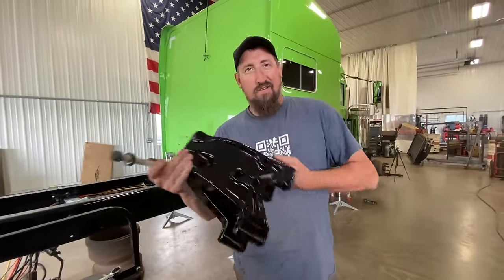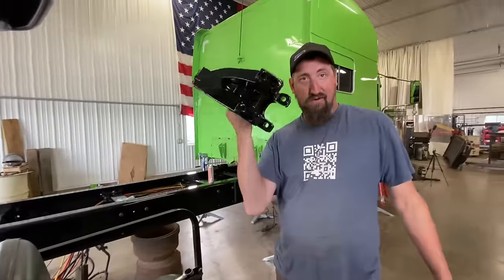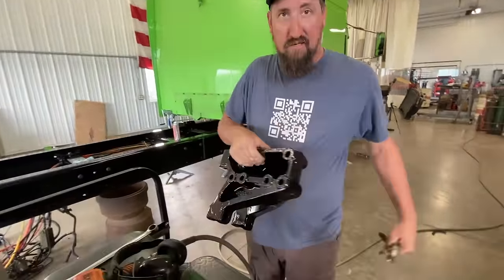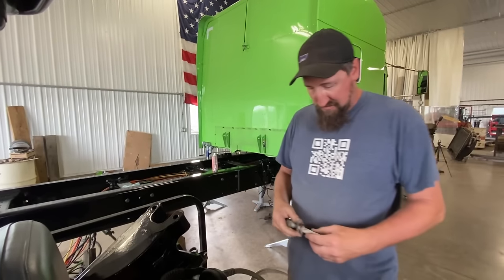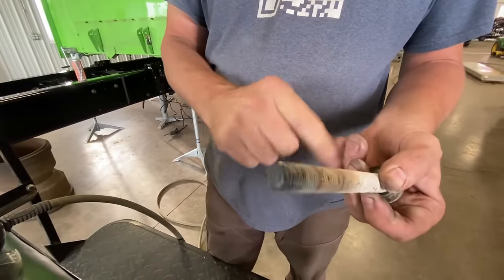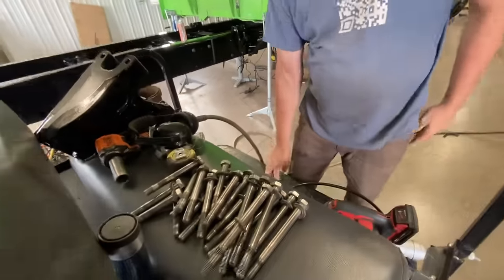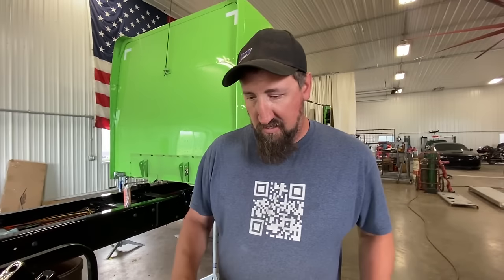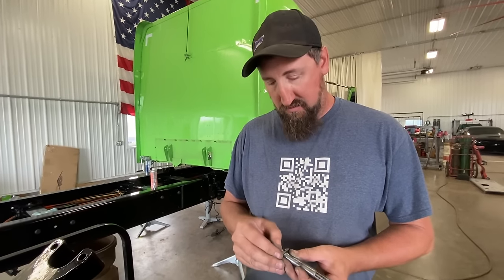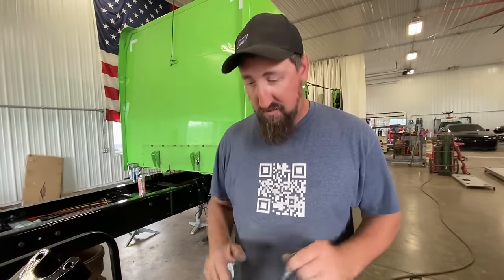So we're putting suspension hangers on. We've got these powder coated because all that needs to be cleaned up. We've got a steel bolt that has all that corrosion, see? Now we don't want to just go sticking that back in there, so what we do is cut that off to the side. We don't order new ones unless you absolutely have to, because the long ones are like $40 a piece from Peterbilt. But we ordered new nuts because they're lock nuts, and I feel safer with suspension parts. We put new nuts on.